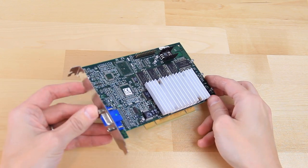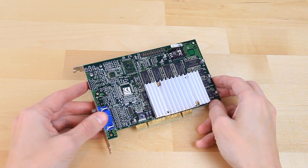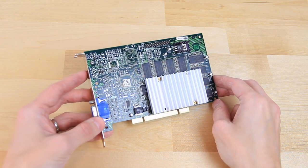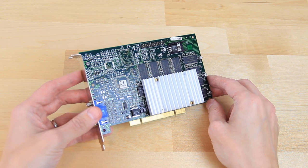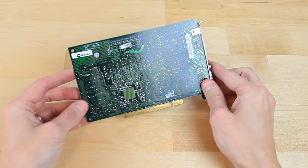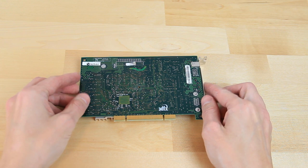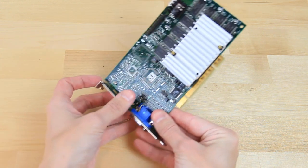This is a Voodoo 3 3000 PCI card with 16MB of memory on board. Partly chosen due to coming across it at a decent price, which isn't easy these days with prices for Voodoo cards on the rise. Although this card is perhaps a little out of date compared to our processor, it has many advantages. It provides excellent compatibility with a wide range of games supporting Direct3D, OpenGL, as well as the 3dfx Glide standard. It also provides an excellent 2D image quality. Put it all together and you have a very compelling card for Windows 98 retro gaming.